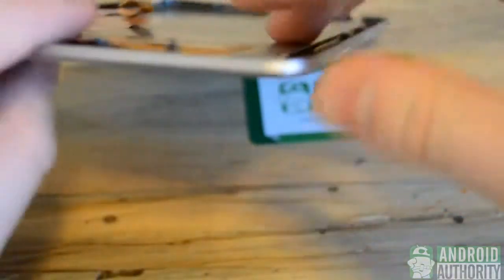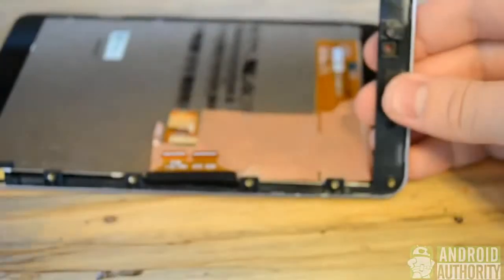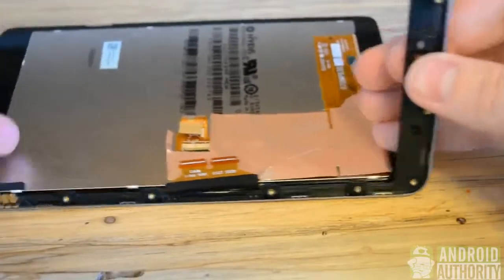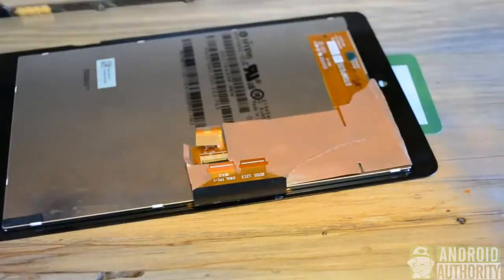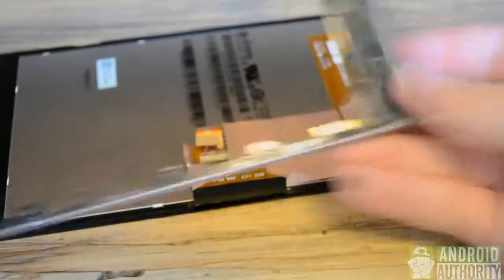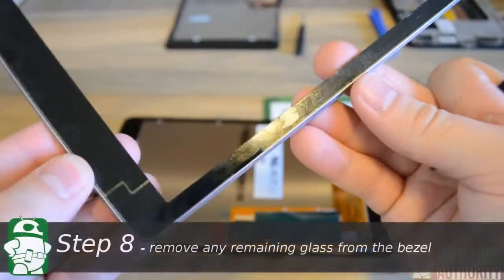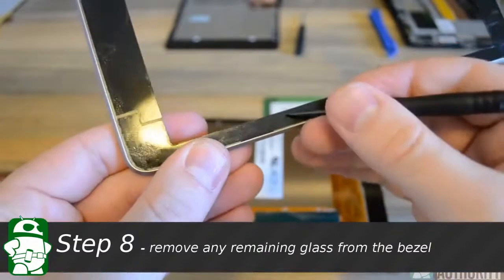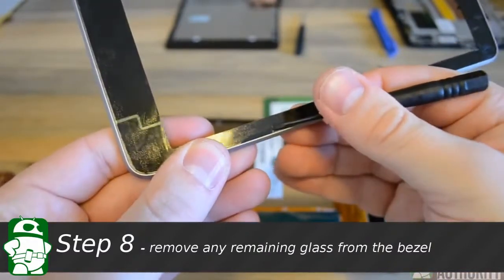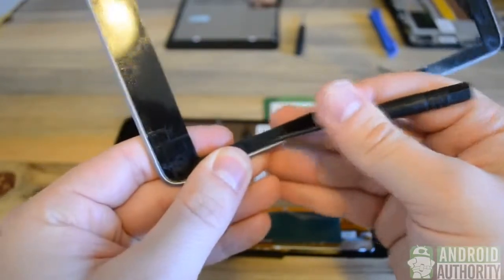You'll want to make sure the glue is hot — I can't stress that enough. If the glue is not hot you'll get a lot of glass on your bezel that you'll have to pick off later. But if you have a successful removal you should not have any glass in the bezel whatsoever. You can see all the sticky tape is still on the bezel and the pogo connectors are intact. It was a fairly clean uninstall with minimal glass on the bezel. You'll want to go through and make sure there are no chunks of glass, because that will incorrectly seat or damage the brand new display. We can simply pry those out with a small screwdriver and make sure it's clear.